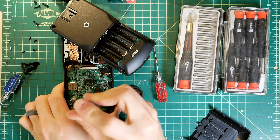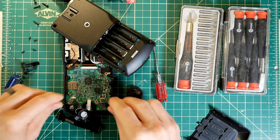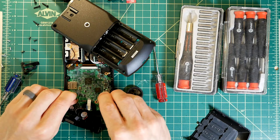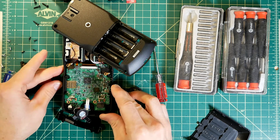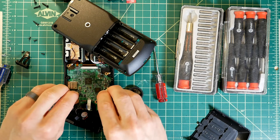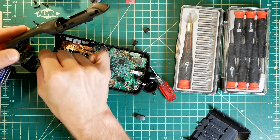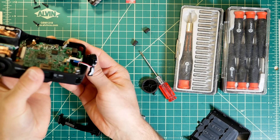At this point, I paused and took a long time before deciding to pry up this PCB. I was fairly confident that there would be a board-to-board connector holding it back, but I was also afraid maybe I missed a screw, or something was glued. To make it easier, I removed the top microphone connectors, but first marked one of the cables so I wouldn't mix them up.